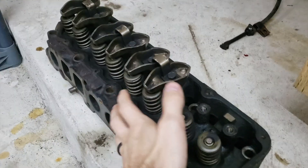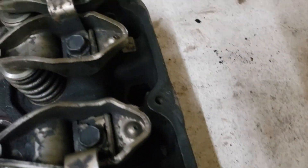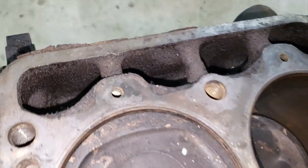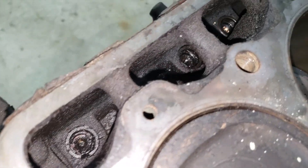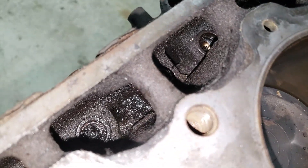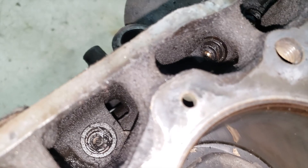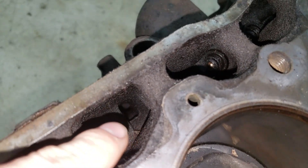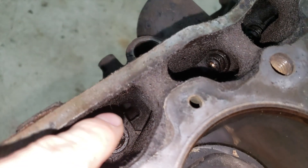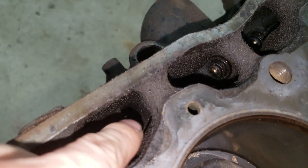When you fill your engine with oil, there's a cover over here. There's a little hole — you pour the oil in here, and it travels down into these holes. From those holes, the oil then travels in here. You can see the lifters — those are hydraulic lifters, and we will get to those more in depth later. The oil falls in here, and then you can see in the center there is a hole. That's why you're pouring oil into the center of the head, because the oil path into the bottom of the engine is right there.